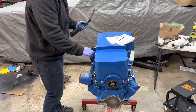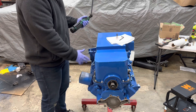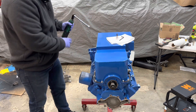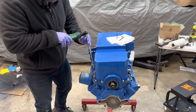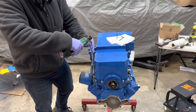For these oil pan bolts, I'm going from the center out — a few in the center on this side, a few on that side, just working my way out. Right now I'm cinching them all down, then I'll come back and hit them with my torque wrench to get them to 10 foot-pounds.